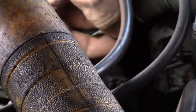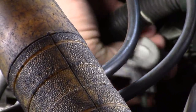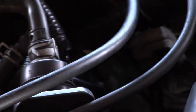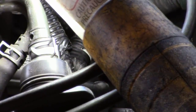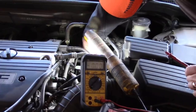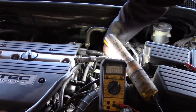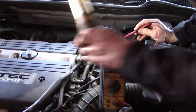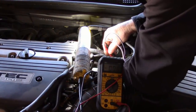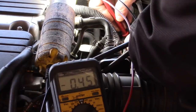Based on my experience, those two orange ones are going to be the heater circuit. On most cars we just need to turn the car on, not even start it, and we should get 12 volts there — one is the power feed, the other is ground, and that feeds the 12 volts through the heater circuit in the O2 sensor. We're on 12-volt scale DC. Dale's having a little struggle because the harness is set a bit deep in the engine, and he's going to probe the two light-colored wires to check voltage.